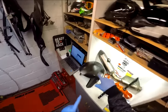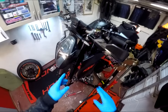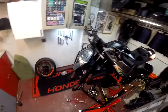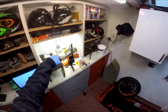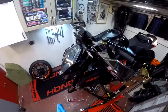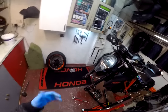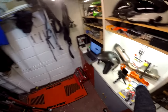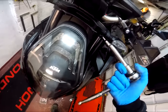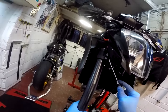I've taken the wheel back off again. I've taken the front mudguard off - or fender for our American brothers. So we're just ready now to undo the pinch bolts on the existing yokes and slip these forks out. I'm going to weigh the stock yokes compared to the billet ones - I'm not sure what's going to be heavier. The billet ones could actually be heavier than the cast ones. We need to get the headlight assembly off next.